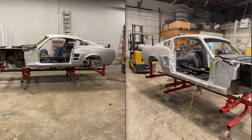That kind of tells me the factory rocker panel welds were already getting fatigued after 55 years. I thought it was really good to go ahead and put the entire kit in just on a structural and safety standpoint, because if an air hammer can separate two or three factory spot welds at once, what's going to happen if you get T-boned? Those welds are really going to pop easy. If you go out and spend $25,000 on a real fastback that needed this complete kit to begin with, why not just start with your coupe?